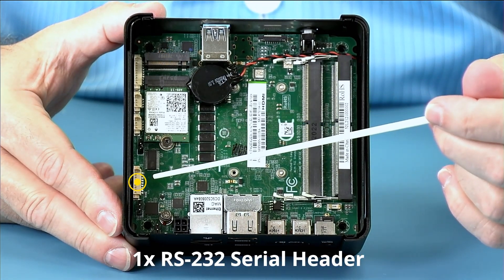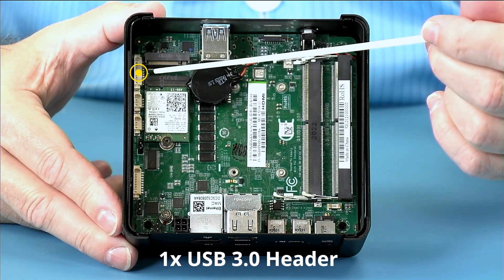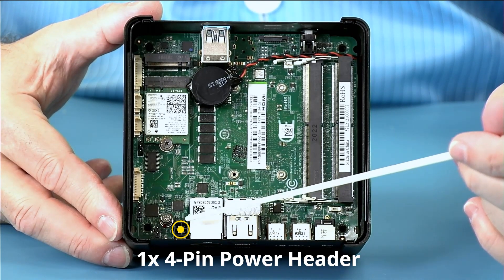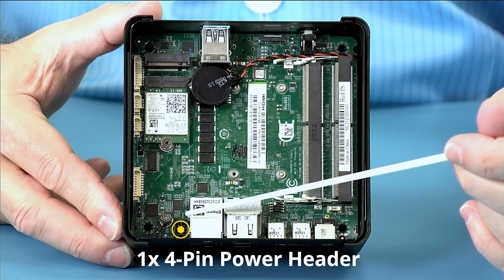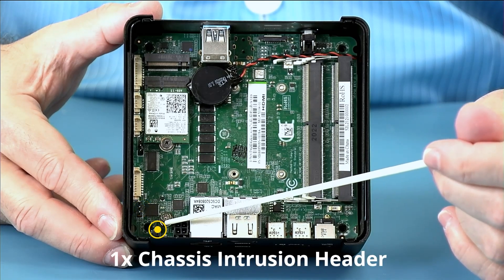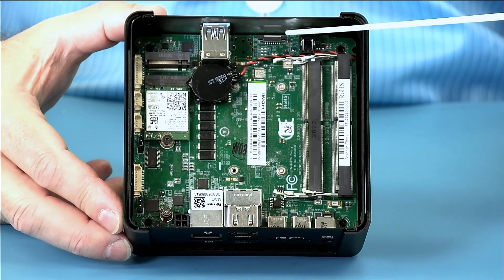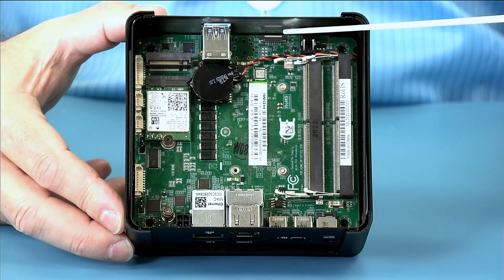You can see the RS-232 serial port, two USB 2.0 ports, and a USB 3.0 port for functional lids or extending your I/O. There is also a 4-pin Molex Micro-Fit connector for plugging in a locking DC cable, powering functional lids, or for PoE. There is a GPIO header and a chassis intrusion header, as well as a user-replaceable battery. Along the front is a flexible ribbon cable connector for the M.2 storage attached to the bottom plate — that's your secondary SATA drive storage connector.